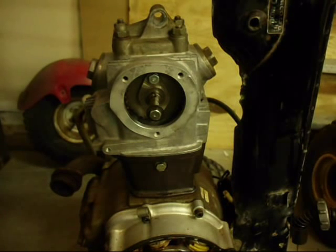The valves are adjusted now. When I adjusted the valves, I turned the adjusting screw all the way down, then backed it off about a quarter of a turn, and that was real close. So you can use that for a starting point when you make your adjustment.